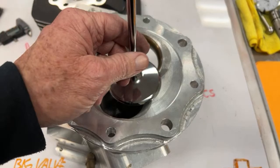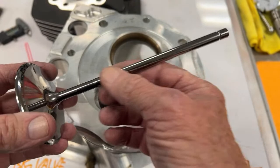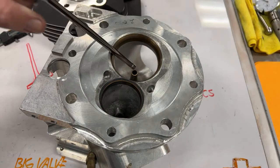but what we were doing, we were buying these a tenth oversize, a tenth. Like if this was a 0.310, we'd get us some 0.311s, then we'd get some 0.312s. No, those are one thousandths, I am sorry. A 310.5, we'd get a 310.6. Instead of a 310.6, we get a 310.7. And what that allowed us to do was tighten this up a tenth.